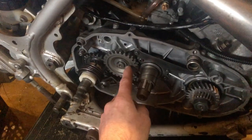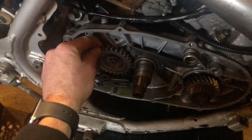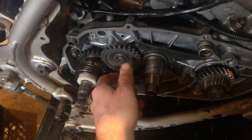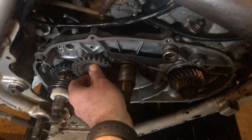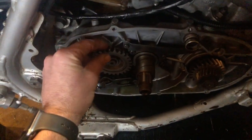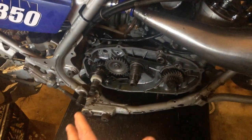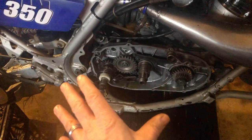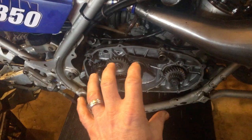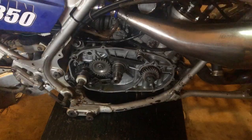Now, I did flip the bushing and throw it back in and already put it back together, so this is not a good reference to show you guys on how much play it has. That's probably how it should be stock, but I flipped the bushing. I just tried that. I knew it might stiffen it up, and it did. Anyhow, it had almost a half inch of play in this thing, guys, so I thought, man, maybe that's it. I know that basket had movement too, so I'm really hoping this diagnoses and fixes the chatter I was getting from the clutch area down here, guys. So we're hoping that's it. I'll post a video right now.